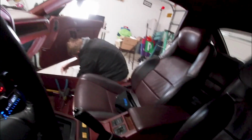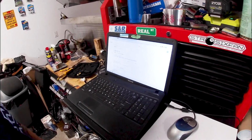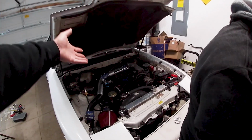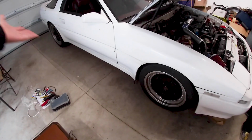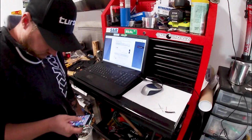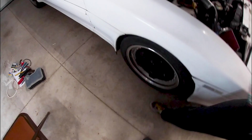So when setting up the rev speed meter, you need to figure out what your factory tire size was, and there is a correction inside the rev speed meter if you've got newer rims and tires, which these are not stock, obviously. So we have to figure out the percentage difference. You gotta do some math. Okay, new tire diameter. Well, the rear tires, right? They should be staggered? No.